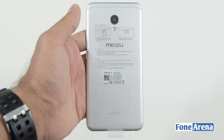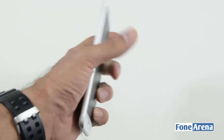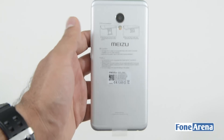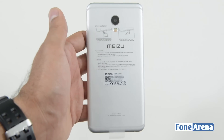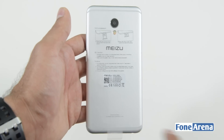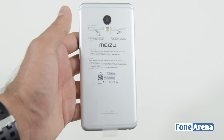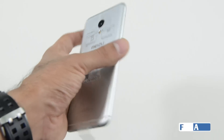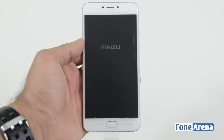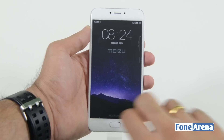The entire smartphone weighs just 155 grams, which is quite light for a 5.5-inch device. The weight is well-distributed, it feels good to hold, and it's not as thick as it looks. The dual SIM card slot takes two nano SIM cards, and the redesigned antenna lines, while not invisible, look aesthetically better than previous generations. The USB Type-C port supports fast charging — the bundled charger handles up to 2 amperes and supports 5V, 9V, and 12V charging.